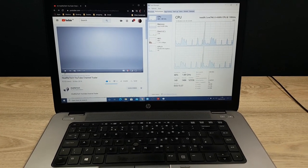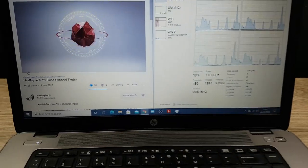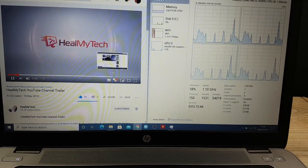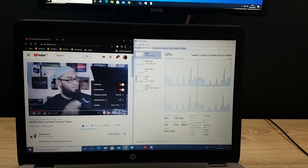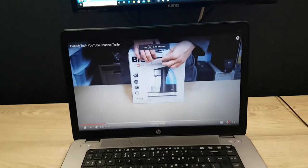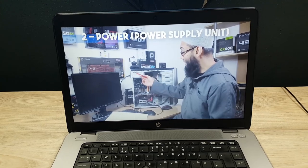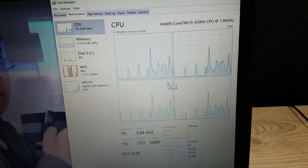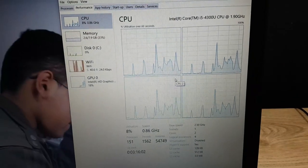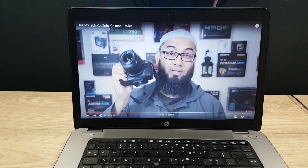Step 9: a video playback test online. Pop over to YouTube and play any 1080p video. Also open the Resource Monitor from Task Manager and keep an eye on CPU usage, disk usage, and RAM usage. If everything is maxing out at 100% just from a 1080p video, that could indicate hardware problems — or background updates running.